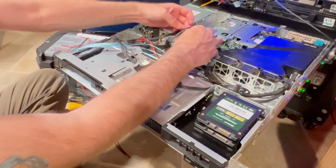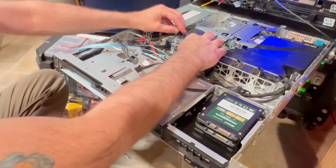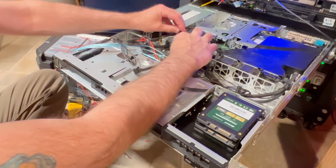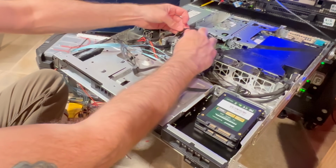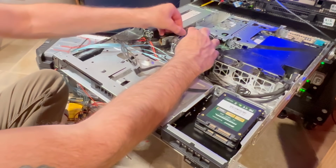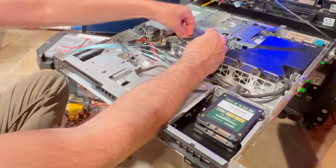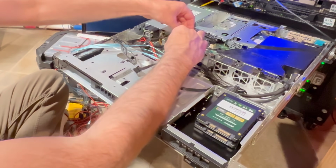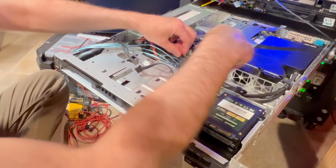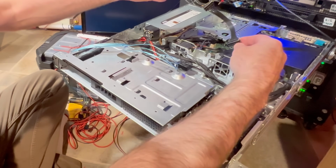Now there's one little catch here. You'll notice there's a white wire right here. When you peel back the wrapped connector, you'll notice this white connector actually goes to a ground. And as a result, that needs to be connected when you solder the connections together, which I did here. So those two are actually ground connections and the other ones are power. Once you have that, you heat shrink them, solder them, all that's good. You tuck them in here. You then have proper power connections that you can mount to your individual SATA drives for the R250.